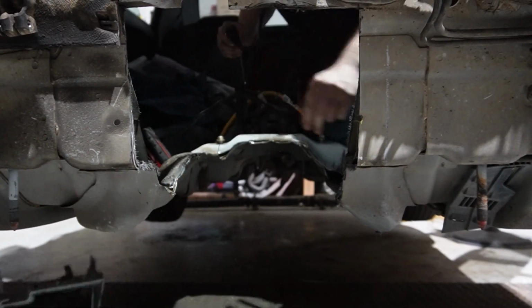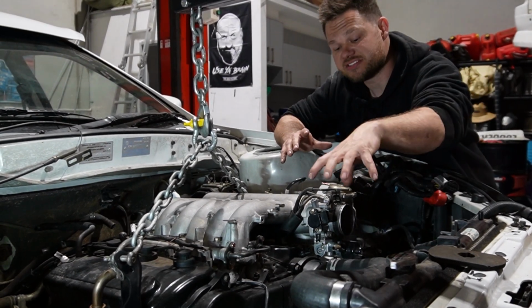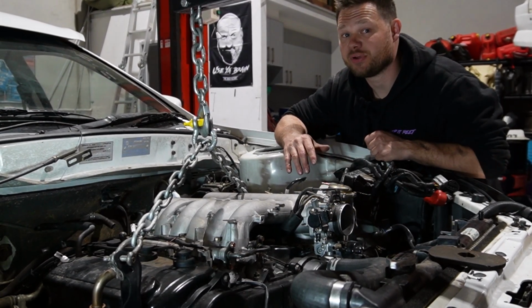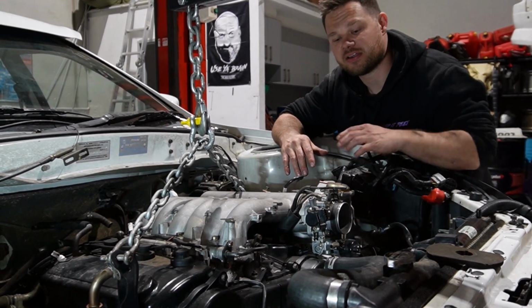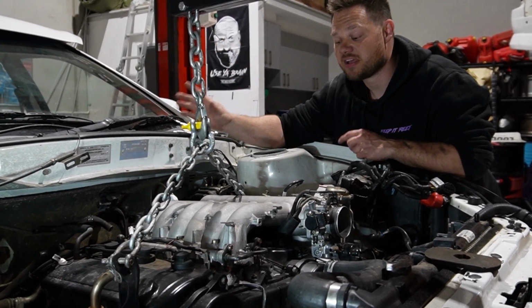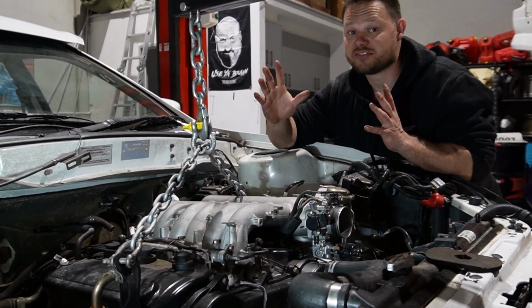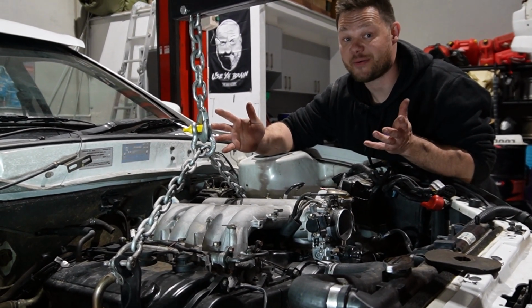And I don't know if you can believe it or not, but I think the best method to do that is going to be utilizing the front engine mount that it came with in its front wheel drive configuration. So we're going to have a bar that runs across the front, mounts the front of the engine. After then, we're going to move on to doing the gearbox. And then finally after that, we're going to do the suspension and we're going to have a rear wheel drive Magna. How exciting is that?